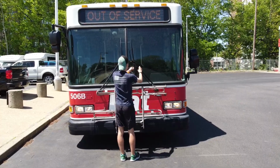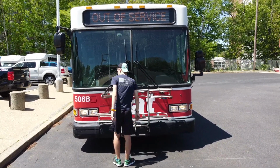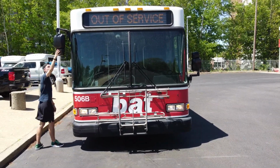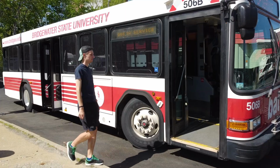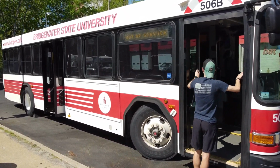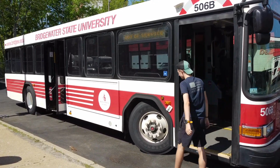Check that the windshield is secure. The windshield wipers have good tension and the rubber is intact. The door side mirror is secure, and the glass is intact and the directional is working. On the door side of the bus, check again for the 3 important things. Once you have observed these, move into the front door. Check that the door has good tension, the glass is not broken, the stanchions are secure, and the weather stripping is intact. Next, move to the fuel door.